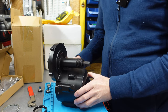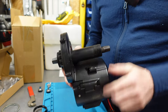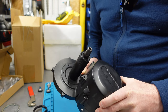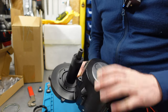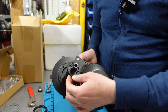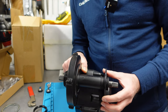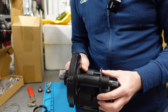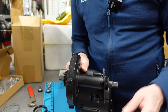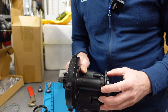I'll show you now how the motor is constructed in more detail. I'll start from the left side, the non-drive side. I removed the mounting bracket. The axle is pretty standard, like in the BBS HD or Tongsheng. Here we have holes for screws for the metal bracket. Using spacers, you can reduce the size of your bottom bracket from 68mm up to 73mm. As I see it, there aren't many more threads available to accommodate 83mm brackets.